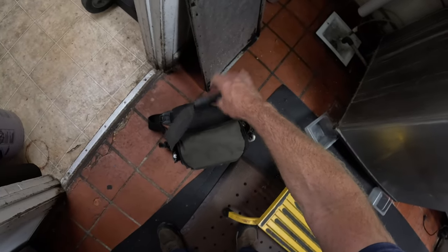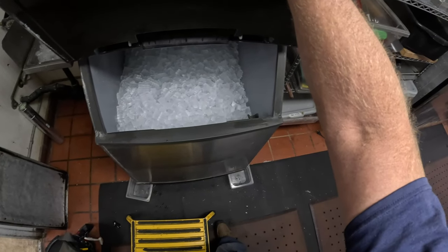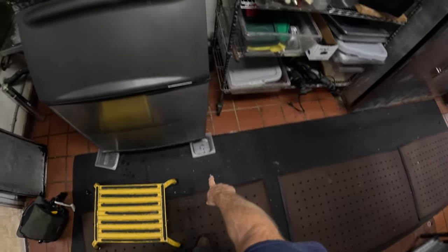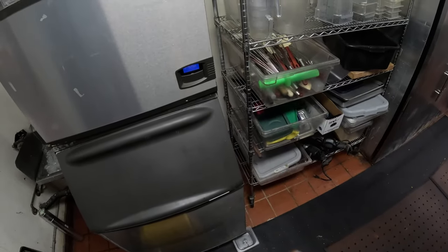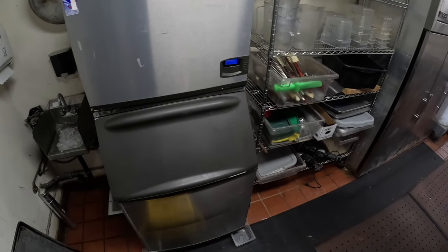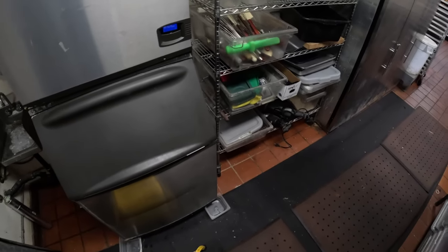We're getting this thing wrapped up. This thing's all back together - we're making ice. Ice thickness looks good. It was a little thick before but we've got it adjusted, and we're back in action. Had some residual water from the water leak but it's dried up. I just wanted to double check and make sure the bin was not compromised - seems to be okay. We got the T4 sensor bad, no big deal. The T3 and T4 sensor is just for diagnostics - nothing to do with the actual function of the ice maker.